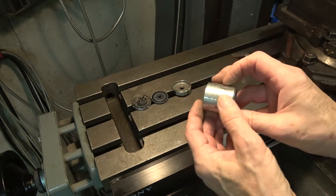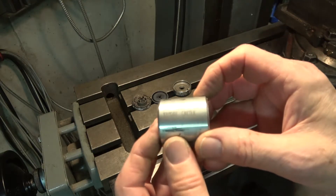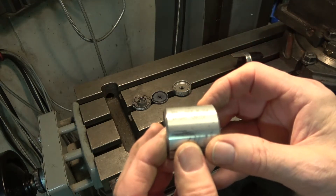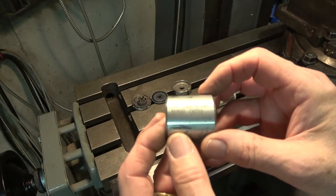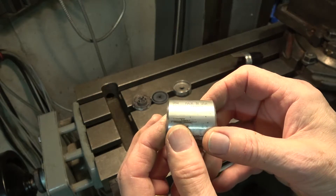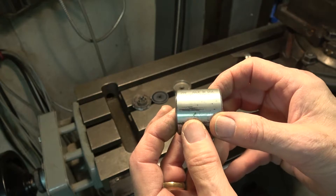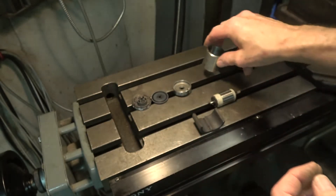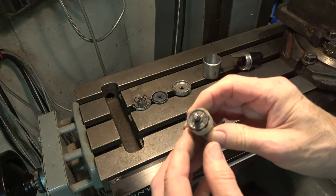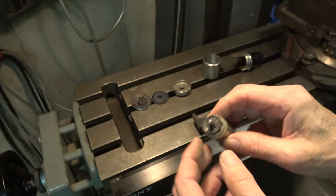Gasoline is really tough. Here's the original manufacturer — you can see it's a Carter, made in USA. And remember, this tractor only has 2,000 hours on it, which to my mind seems like this pump should have lasted longer. But it is clearly worn out, and there's nothing that could have been done with it.